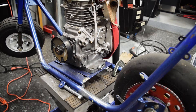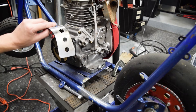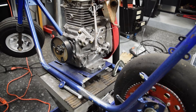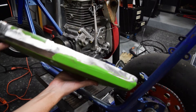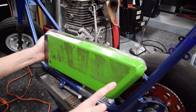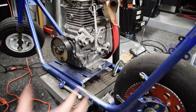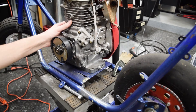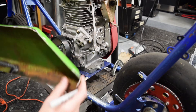I've been doing a lot of cutting and grinding — stuff I really hate doing and put off as long as possible. The front footrests are gone; the far side needs to be ground down smooth, this side's fine. The original chain guard was just some cheapy stamped garbage that didn't really protect anything. So I got a rototiller a while ago — I really only wanted the engine — but I kept the belt guard and cut it all up to make my own chain guard. I had to add in metal sections, add a corner, and so on. It's not great — I'm not super happy with how large it is, it's kind of just like a big wall. Everything's still kind of in place and in the air, and I really need a bandsaw because these lines are not straight whatsoever.